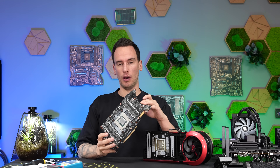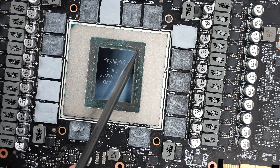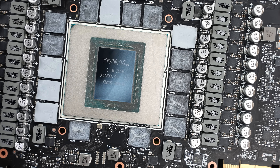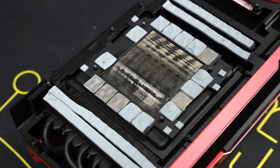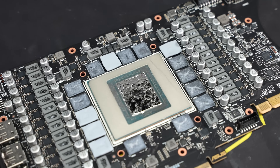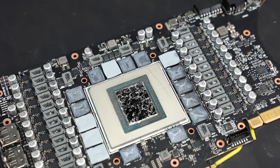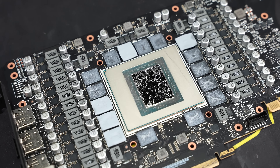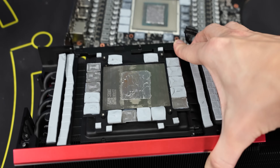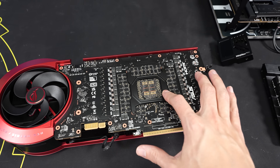Now cleaned, it all looks absolutely perfect — all the SMDs were properly protected, nothing went under the protection, so the GPU was never at risk of being damaged. After cleaning the other side, everything looks pretty normal — nothing unexpected. I notice it's number 157, not sure if that's the card number, but everything looks fine. With the classic method of applying liquid metal you just need a very tiny amount, and then you shouldn't need the barrier around it. I applied a very thin layer — that's enough; everything squeezed out to the side is not necessary. The PCB is back on the cooler and the spring mechanism is in place — just have to reassemble everything.